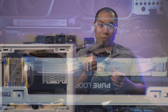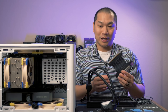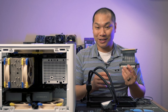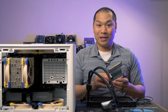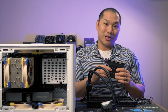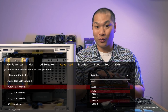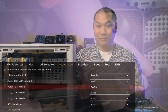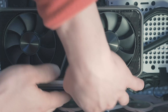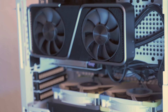On this riser cable, there is something fairly important to note. With all the X570 ITX boards I tested, none of them auto-assign the PCIe slot to PCIe 3.0 properly, meaning you'll just get a black screen on boot. The included riser is PCIe 3.0, and if your board supports 4.0, you're best off putting the GPU into the slot directly first, setting it to 3.0 in BIOS manually, and then installing the GPU with the riser cable. There isn't a huge detriment to performance by going from 4.0 to 3.0, at least not with any of the GPUs on the market now.